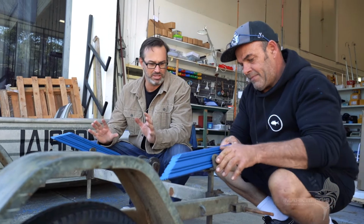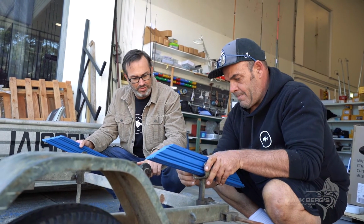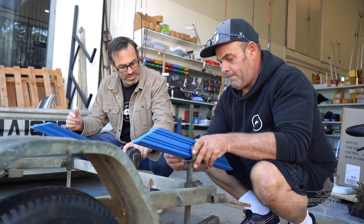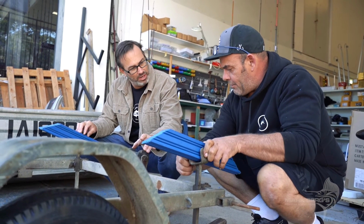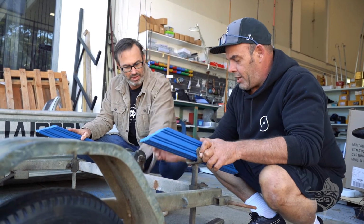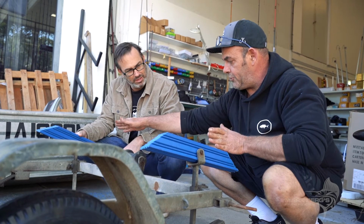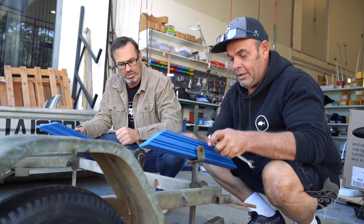So obviously a bigger trailer is a lot more complex, but at the back here, the first point of contact really for a boat that, this is not a complete punt, it has a V, yep, it needs to be this center roller. Absolutely. So do you think that needs to be slightly higher than these, or roughly the same height? Roughly the same height, and it all depends where the boat sits once it's on the trailer. Yep. But back to these skids, the way you were explaining before, being a V nose punt, it will be the nose of the boat and the two sides of the V that'll touch first. It'll go on straight. They locate themselves straight away. It's a bit of trial and error.